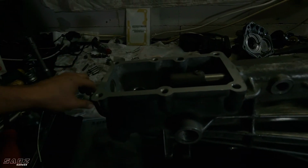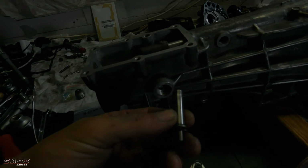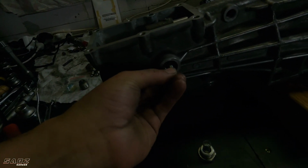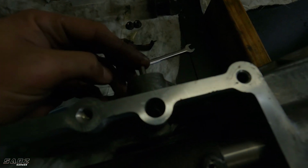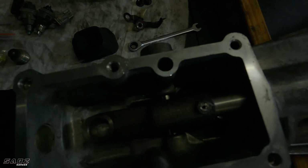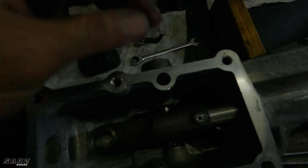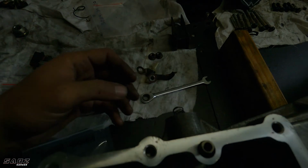The sides here, there are springs, washers, side screws. They go in here, but before you put that, you have to put these. So these go in, they slip in like this. This one has a notch in it, and there's a reason for that, because there's a ball that goes down this hole. So that goes in like that. And in there fits a ball bearing, which is this little ball bearing, goes in there. Spring goes on top. We can now slip in the springs, and then we can fit these.